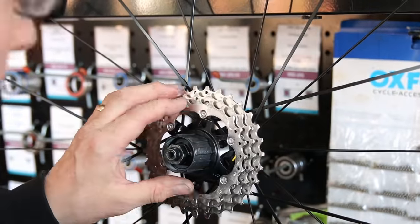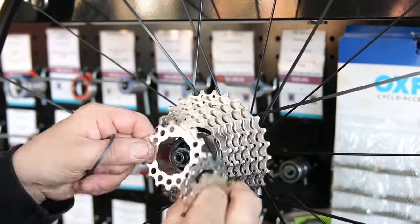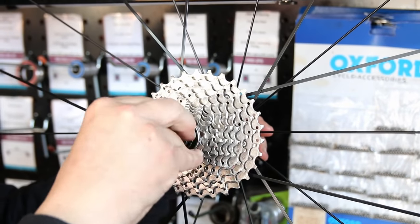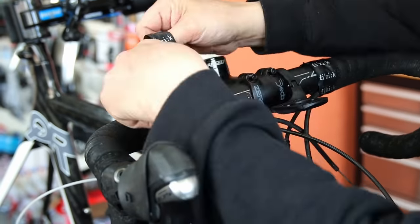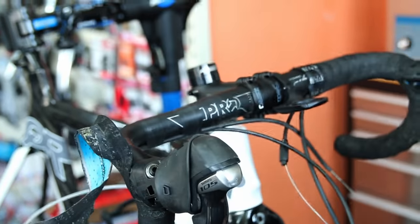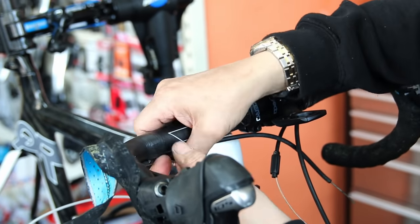Just putting a little bit of grease on the hub before fitting the cassette. Next week's video features a wheel in immaculate condition, but we had a real job getting the cassette off because it had corroded where it had never been lubricated — so watch out for that next week.